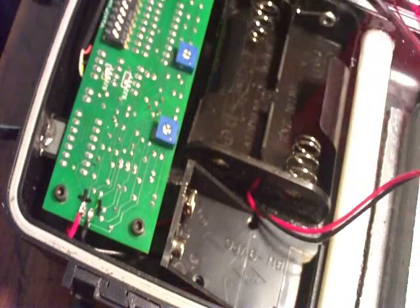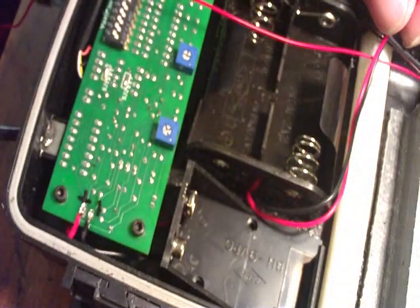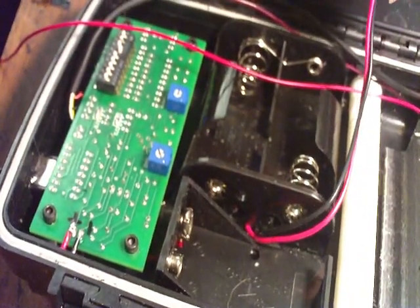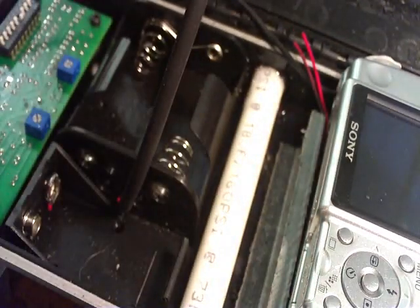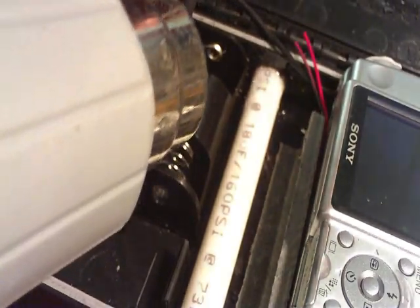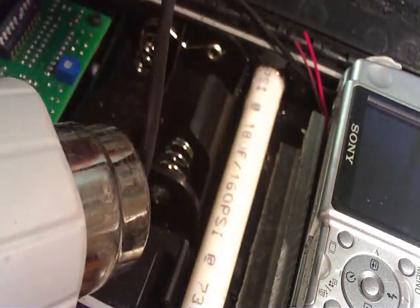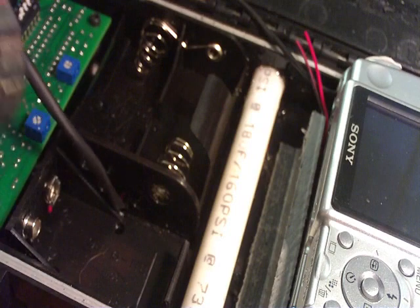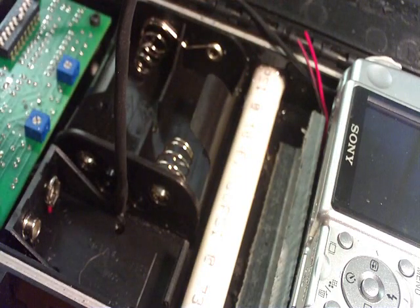From my camera, I can put a connector in here, but I'm going to wire this one right to it. So I'm going to cut the wires and solder her up. Make sure your batteries aren't in. I'm going to slip some shrink tube over top of my external wires from my external batteries. We don't want to overheat it — just want to shrink it.